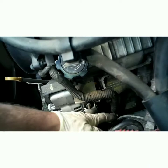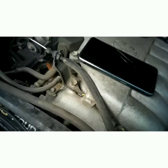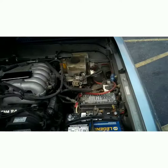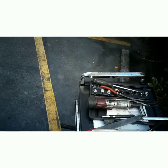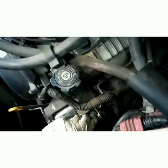I didn't even mention — always compare your plugs. For those of you doing this at home, make sure everything looks the same, because I've had alternators where they'll bolt up and then the plug is different. Nothing pisses you off more than that — especially your own stupidity. When you do this for as long as I've been doing it, you learn. Nothing better than having to do something twice to learn your lesson. Pop that little cover back on so it doesn't arc against anything.